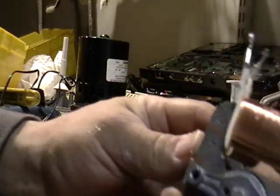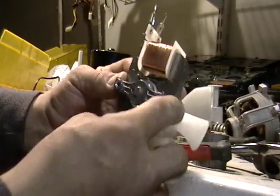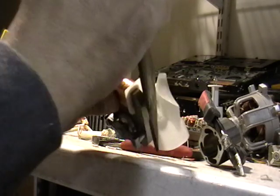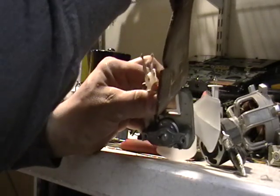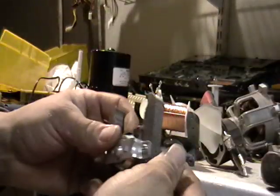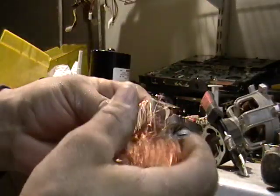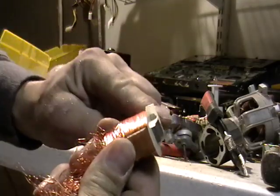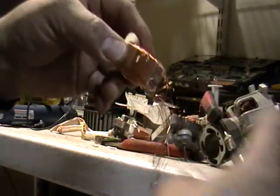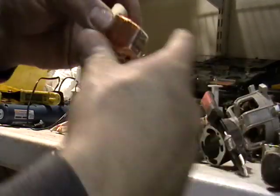This came from a microwave. I'm going to show you how to get this out. What I did was I used one of these — you place it on top like this. You've got to get this fan out first. You place it on top and you pound this side of it. When you pound this side, it'll look like this once you pop it off. Take it off, and you cut the edges — these tips here. Cut it all off and it looks like this. Again, this is bright wire. Look how easy that comes off. Wouldn't you like all your copper — all your bright wire — to come out that way?